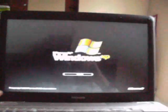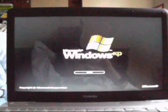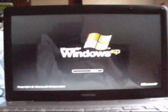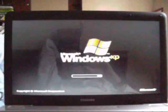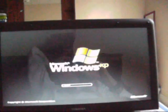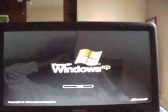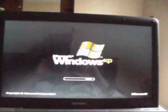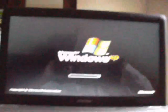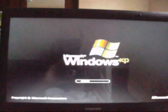This is how I got XP to work on here. First of all, I had to go into the BIOS and set the compatibility mode from AHCI to compatibility. I had to change the compatibility in the BIOS. I'm going to put XP on a little 60GB partition.